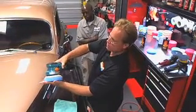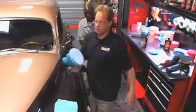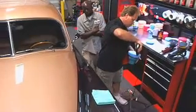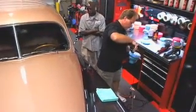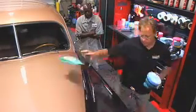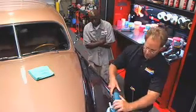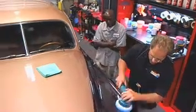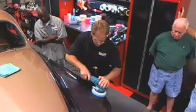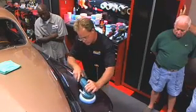And that's just like the Flex 3401. That is now forced rotation. So you would use that the same way, since this is primed. Come down here and work this fender a little bit. Again, cord over shoulder. Put all the pressure down here, not here. You'll buff crooked. Spread your product out. Slow down. And then just make overlapping passes.